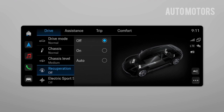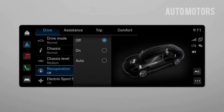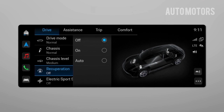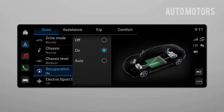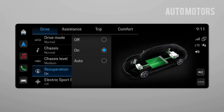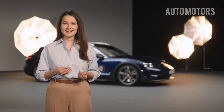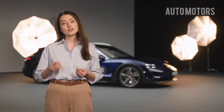If the mode is set to off, your vehicle uses its kinetic energy to coast for a longer distance. If you select on, the overrun recuperation with moderate deceleration of the vehicle is active. Similar to brake recuperation, energy is generated to charge the battery. Your selected setting is shown on the instrument cluster.